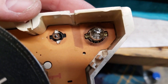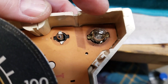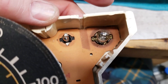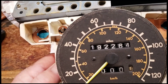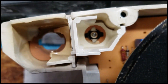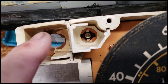The dash light on the right-hand side — I wasn't even able to get it in there and turn it, and the reason why is when you press in a little bit, it moves. That's not supposed to move. So what I'm going to do is take some plastic epoxy and put a dab in the corner right there to keep that from moving in the future. It's now clear that the left-hand side bulb for the dash lights has been getting very hot over the years.